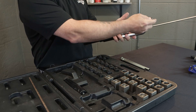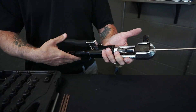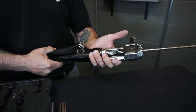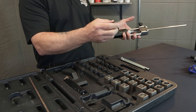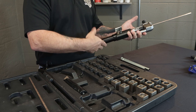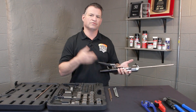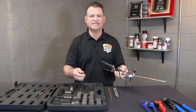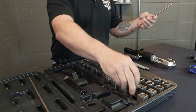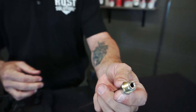We'll go over all these flares. First thing we're going to do is a quarter-inch inverted flare. So I have the quarter-inch OP1 — you will just go until it stops. The form will seat right up against the back of the die. Then you'll have your OP2, that's your operation two — this inverts the flare for you. You just pump against the material. Once the 45 hits the material, it's three to five pumps. Once it stops, don't crush. You want to create that flare and seat it while you're installing the line. And pretty much that fast, you get yourself an inverted flare.